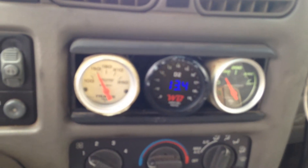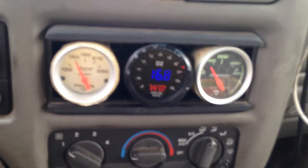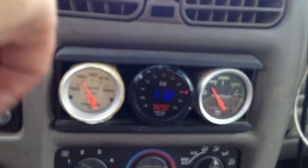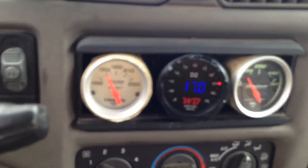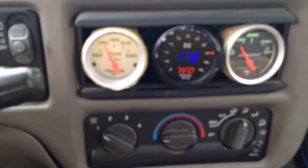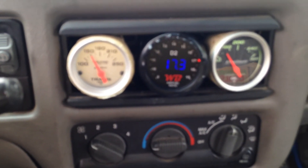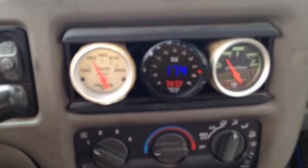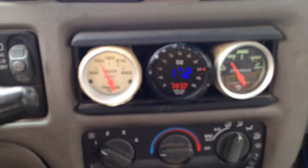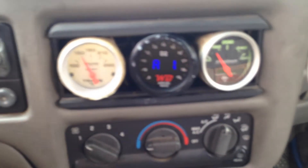That's okay — there's still a lot of adjustments and learning to do on this truck. It's a big learning experience because nothing on it is extremely proper. But successful test drive — nothing blew up, nothing fell off. I welded exhaust in, it's pretty cool. I might be tuning tonight, and I'm going to try to see if I can adjust this, maybe wrap some header wrap around the exhaust parts I think are leaking. I think it's mainly one junction that I have a question about with an exhaust clamp — there's no way it's running that lean.